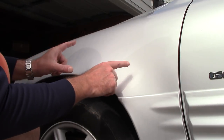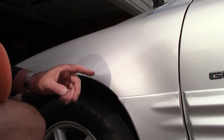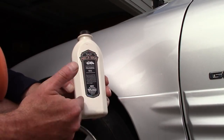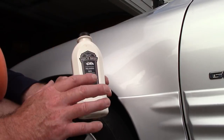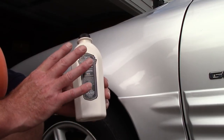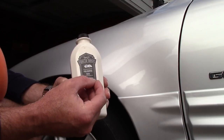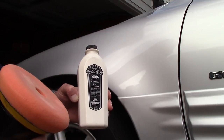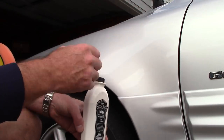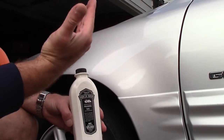Looking at this part of the panel, I've restored some nice shining gloss and removed some very light swirling. For an all-in-one retail-grade product that gives you light swirl removal, it's great for well-maintained cars where you just want to spruce things up every six months or once a year with a quick DA polish. The fact that you can get it just about anywhere — I think you can pick it up at AutoZone — and it's priced right, makes it one of the best retail-level cleaner waxes. Too many retail cleaner waxes flash too quickly and don't work well with a DA polisher. I'm giving Meguiar's two thumbs up.